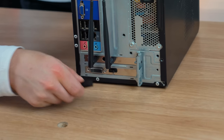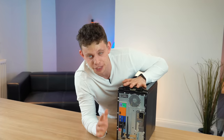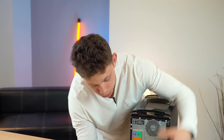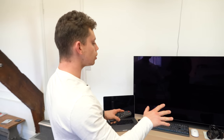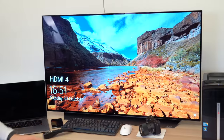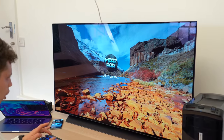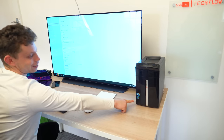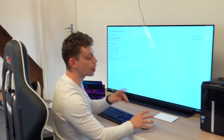One thing I did want to mention is that we've upgraded the RAM, upgraded the hard drive to an SSD, and now put a GPU in here. That's a crucial part in making this computer faster because the processor in here is a first gen, really, really old. So if we can offload anything from that processor — like the graphics stuff — to an actual GPU, that's going to free up our processor to do processor things. The TV is plugged into the GPU's HDMI port, so if we get image on here… it's on already. That literally started up in about three seconds. That is unbelievable. We are currently outputting at 4K from this — it has a Windows 7 sticker on it. Just to double check, we are running at 60Hz, so 4K 60 is achievable out of this old computer when you put a GPU in it.